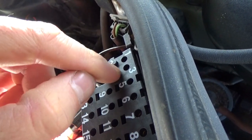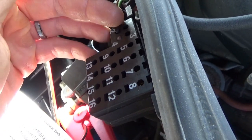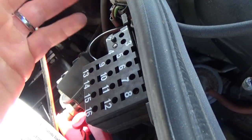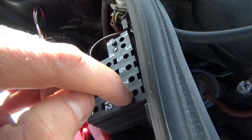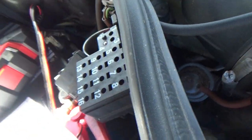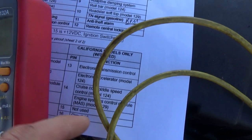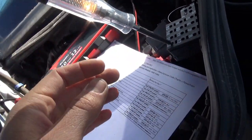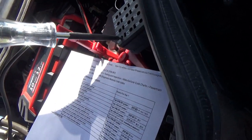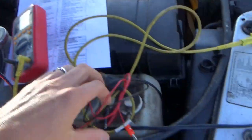That's a problem — that's not how this system is supposed to work. Let's see what voltage is on pin 3 to check if the diagnostic module is alive at all. We don't really need it, it's more of an emissions thing, but then we can go for pin 8 — the engine control module. First let's check pin 16 (circuit 15) — power confirmed. And pin 1 should be ground — yes, that's a good ground. So we have good ground and power, we can do our checks with the little LED pulser tool.